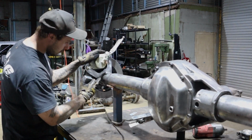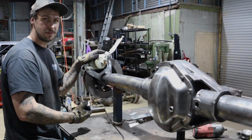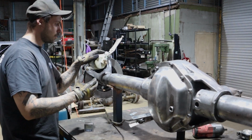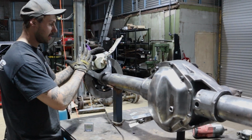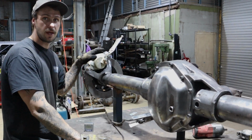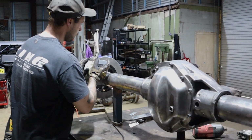And the preparation that we've done on here is key, because you can see it's pretty much to the millimeter of sitting that on there really nice. If you did that and you scalloped it out or it wasn't nice, it wouldn't sit great, so you'd be fighting even more factors, because we've got rotation, angle, we've got compression of this being seated and true to the brake pads, and then you'd add that variable in there of it being wobbly. So at least we're minimizing the amount of things we've got to do. So chuck that on here, and